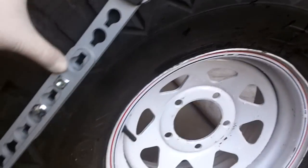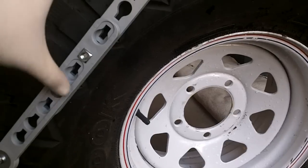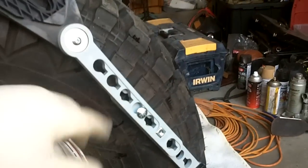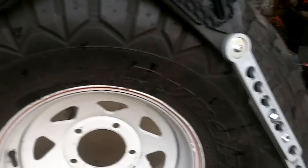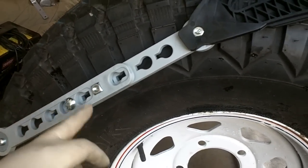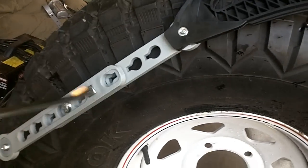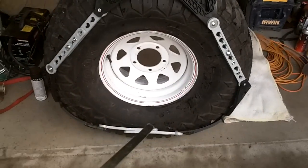All right, we got them on. I found out that for my tire size it's one past where the carriage bolt is, so I'm going to mark that on all of them as a reminder. The easiest approach when putting them on the vehicle is to pre-set the back strap to the correct size so you're not back there adjusting under pressure. The second notch is perfect, so all the back-side pieces will already be in that second notch. When I come to put it together with the tool, all I'm doing is tightening three attachment points at the front outside of the tire.